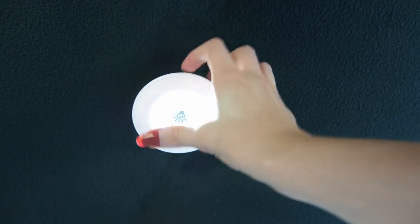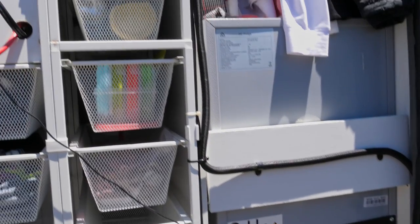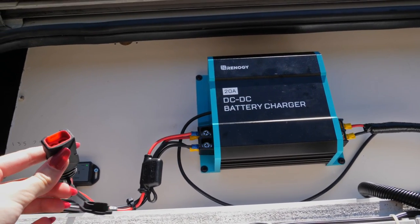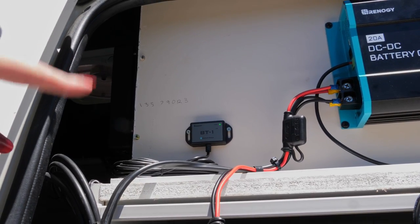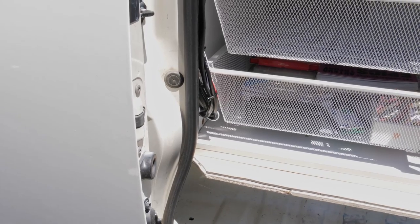As for the lights, I have two built-in lights that are powered off the van battery, and then I also have some puck lights which I put magnets on the back of, so I can stick them around the van and push them to turn them on. By opening my right-hand side sliding door, we're able to access a lot of the electrics. I've got my fridge plugged in there, and then this cable runs from the van battery via my DC to DC charger to the secondary battery, which is mounted on the back of the wardrobe and also has my 240V inlet attached. The Bluetooth piece connects to the charge controller on the side of the wardrobe, and going down we can see the inverter and the back of the 12-volt sockets and the fuse box, which all runs down through a hole at the bottom into the battery.